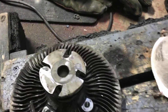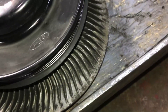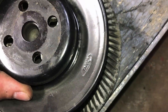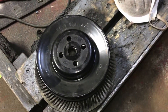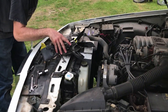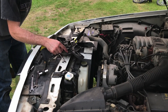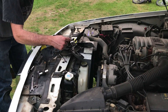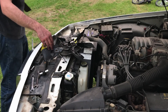I've solved my problem. I've gone ahead and just taken my grinder and notched all those holes in, and I even ground around the outside. So if I put it on the center hole now, I think it's all lining up there, so we're going to give it a trial fit. You can see I have the fan blade on here again — this is the Lincoln one. I actually went through a lot of work to get it on this Ford clutch because it doesn't fit. This was bigger and I had to grind it down, as well as notch out the holes. And I had to notch out these holes in the fan blade. But it's going to work, so I say it was worth it.